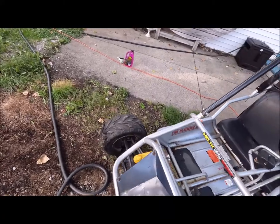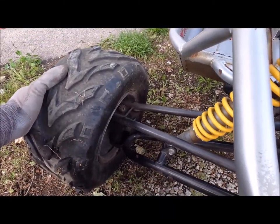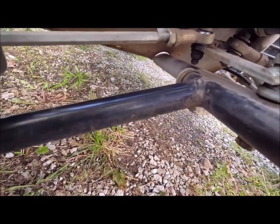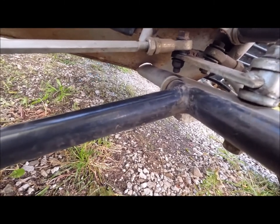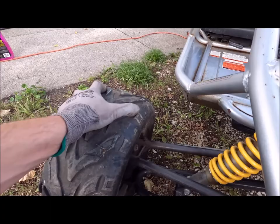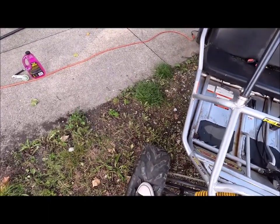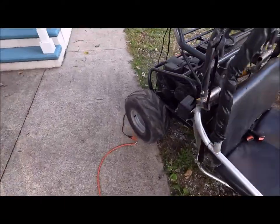It probably has parts that are a little older — it needs a lot of linkage replacements, ball joints for the steering. This one I swear it's just the bolts loose, yep, so I'm gonna fix that one. I probably got to order some parts too; the spindles are kind of loose. The tires are blown out so I need to replace the tire — I'll probably get a whole set of four, at least the front for now.